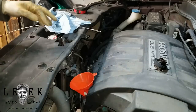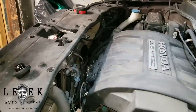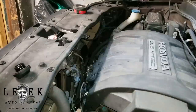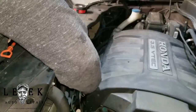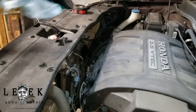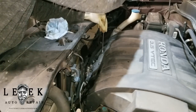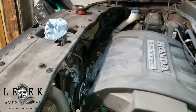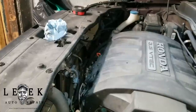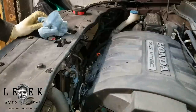I've emptied the full jug — all five quarts are now in there. Wipe the dipstick clean, put the oil cap back on. Sometimes I put a rag over the opening on sensitive cars that can trigger a lean condition, but that's another conversation. Fire the car over, let it run for a second, then check the level again.